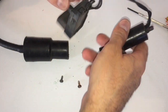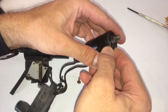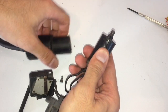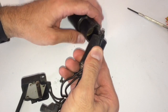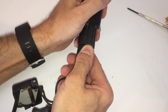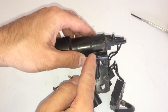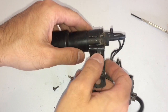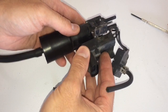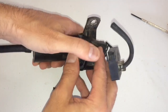So now we're ready to put on the filter. You're going to want to bend these wires back gently — you don't want to cause a break in them — just gently bring them back. You have that groove inside the filter, so just slide this in gently. Next, go ahead and put the bracket back on it — you're going to have to expand it a little bit, it's very tight to slide it over. Then take this piece, clip it back underneath — there are some pins where they clip through — and go ahead and attach that.